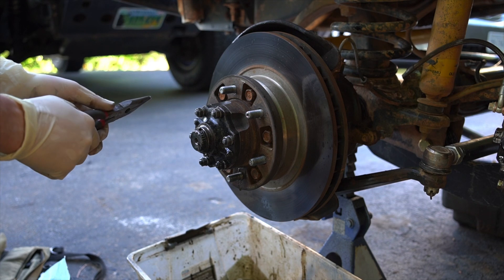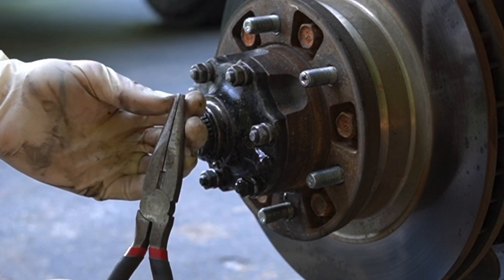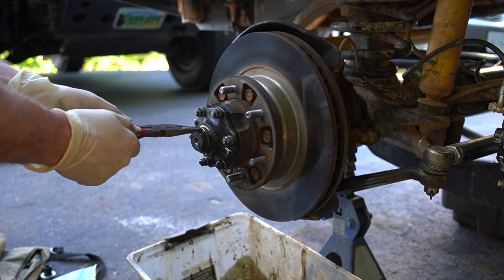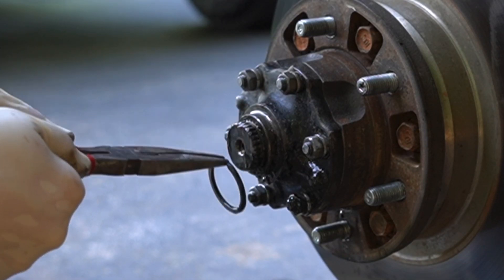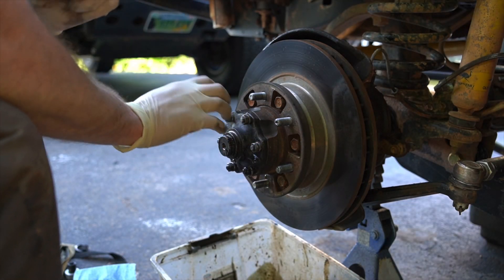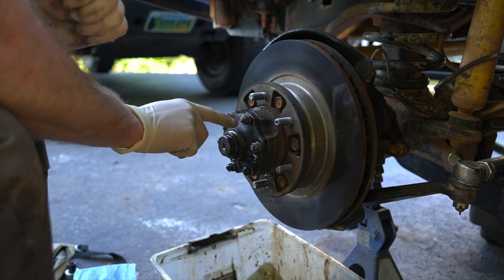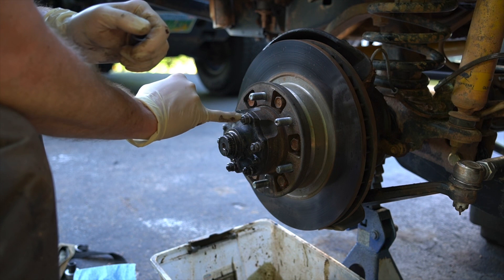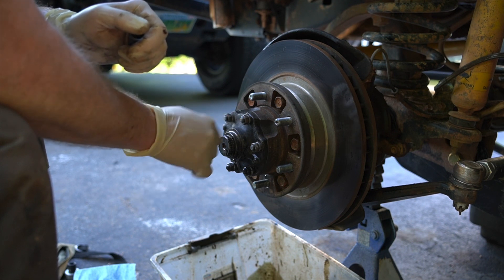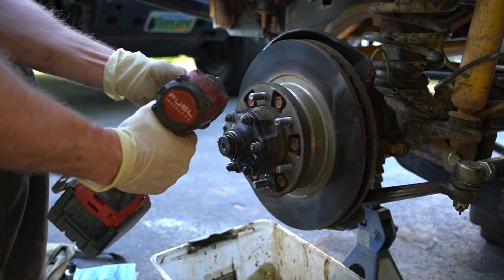There's a snap ring on the outside of our axle. If you don't have snap ring pliers, you can just modify a pair of needle nose — put two notches in them and pull apart to get it off. Next we're going to work on the bolts that hold our hub flange on. If they've been off recently I'll take an impact to them, but if you don't know if they've ever been off, test them with a ratchet first. If they're seized, you may have to heat them up. If you just hit them with the impact you could end up with a broken stud in your hub assembly.